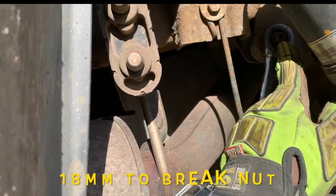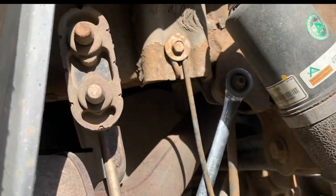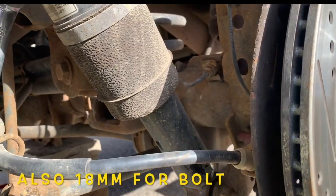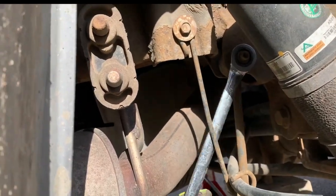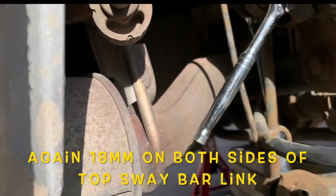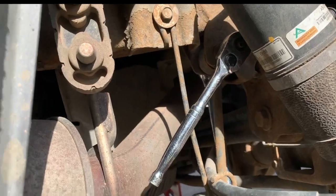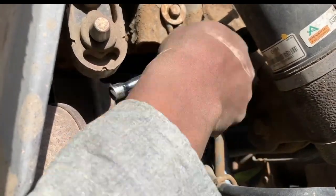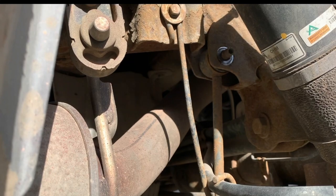For the top, I just got an 18 wrench — it's a ratchet wrench. You eventually have to remove the shock as well, so you can remove the shock and go back. I'm just going to remove this one here — not too bad with the ratchet wrench. Now that I got it broken, I'm going to use an 18-ratchet on this side, and on top there's an 18-head bolt on the other side. So I'll ratchet away, then get a hammer and knock it out.